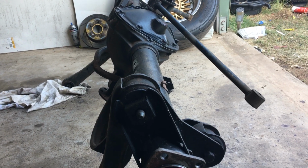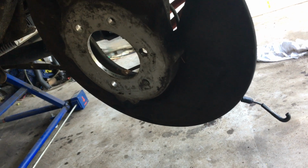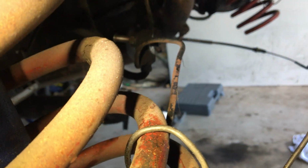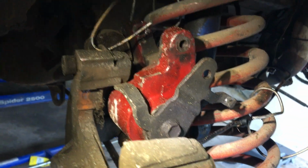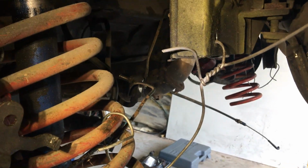The only difference was the brakes on this one, and I left all the brake gear on board. Being disc brake rear, I left everything up in here. I just undid that off the diff and suspended everything off where the linkage setup goes, which holds the springs up, and the springs hold up the calipers and all that. It's all supported, so I'll put it all back together. It just saves pulling all the brake system apart.